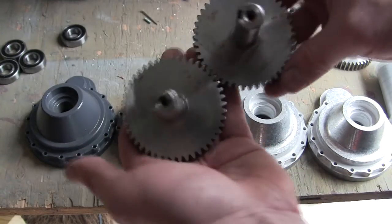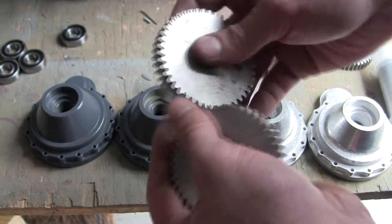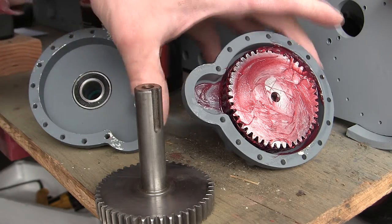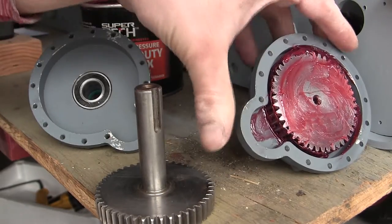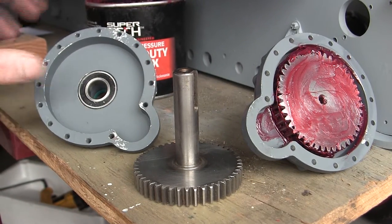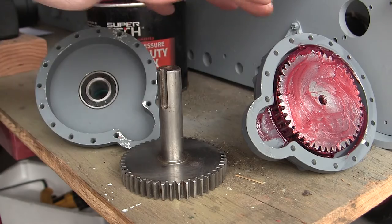For the pieces being as old as they are, they are in excellent condition with only a few small areas of surface rust, which prior to assembly will be buffed down and removed. Here go the final drives going through their assembly process. This unit here is fully completed and ready for installation, while this unit is currently awaiting lubrication on the final drive gear. I like to heavily lubricate the final drive gear before adding it to the casing and then mounting it to the vehicle.